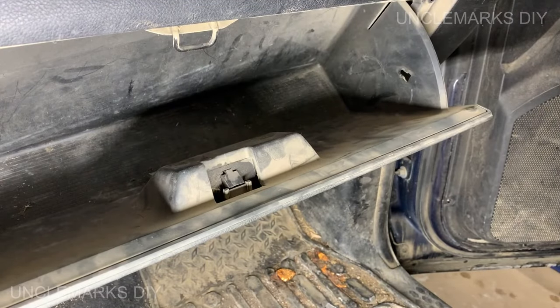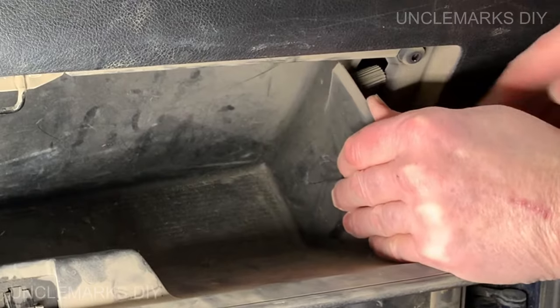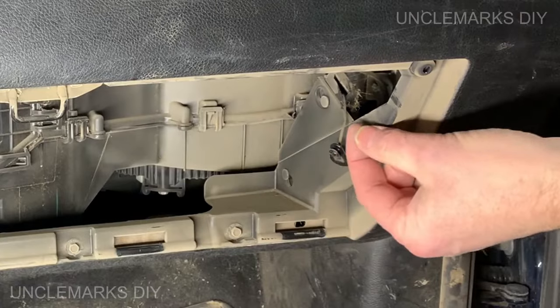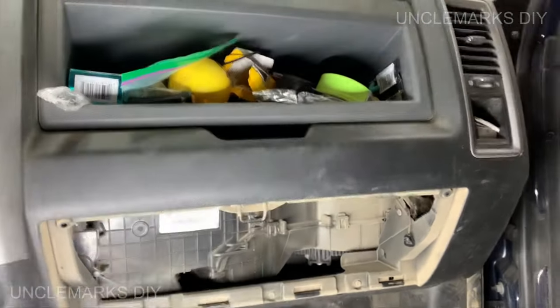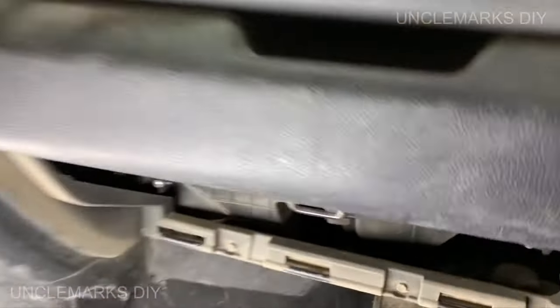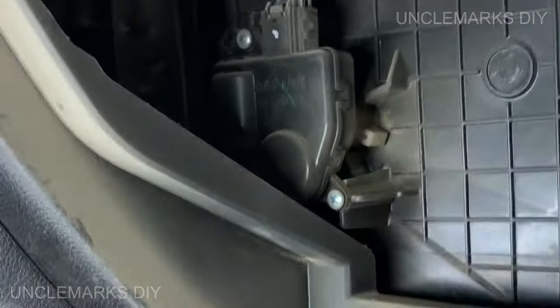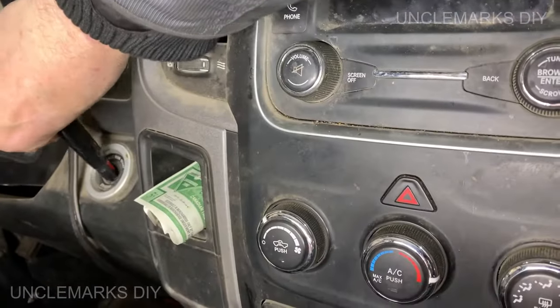Anyway, to get to that little motor, you have to access your glove box door. There's a little string there that helps the glove box open slowly so everything doesn't fall out. Once you get that out of there, move these little fingers — there's a little tang, a little finger — push those in. Get that wire off, get that little string off first so you remember to put it back on later. If you look inside the glove box on the left-hand side, there's a little motor that opens and closes — it's the blend door motor for heat.